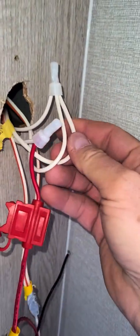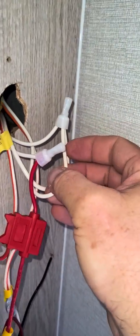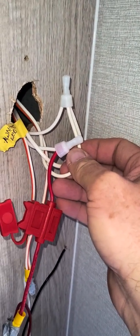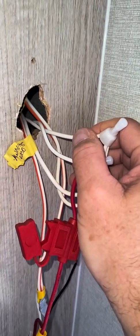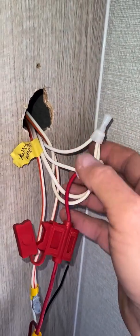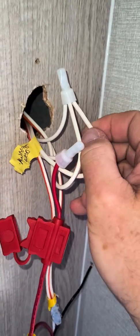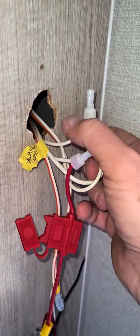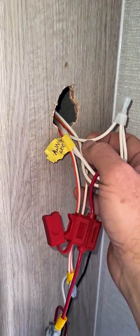All 3 of the solid whites come together here. So one of these is the TV antenna ground, I presume. The other is the awning light ground. And then the other is fed off the blue-white. And I assume this white is the ground to the coach. So like I said, one's an awning LED ground, one is the antenna booster ground, and the other, I presume, runs back to the coach area.